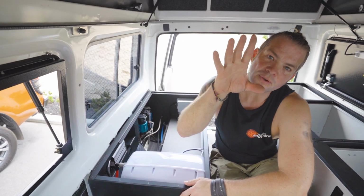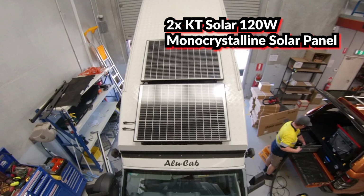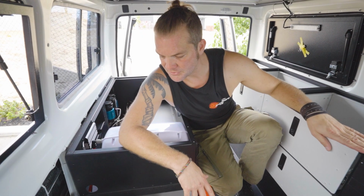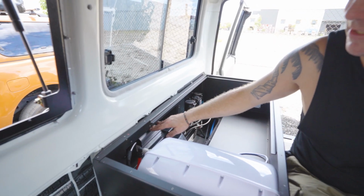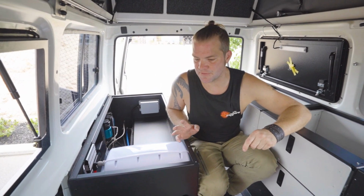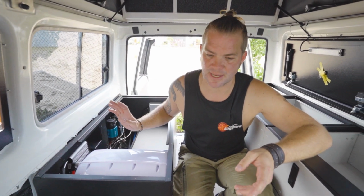And now the roof solar panels, because they have got an extra regulator, will also do, depending on the situation, 10 to 15 amps from the roof. So that means instead of using this internal regulator, and then we're limited to just over 40 amps, we can get almost 55 amps of charging happening when the sun is shining and the engine is running.